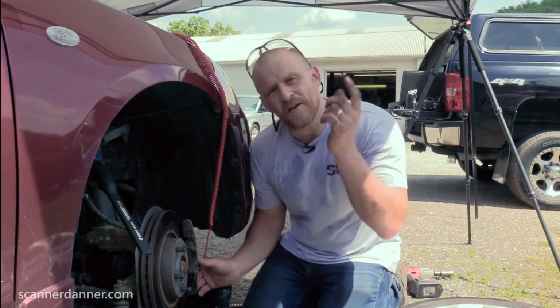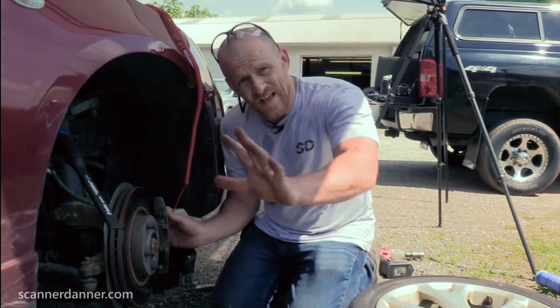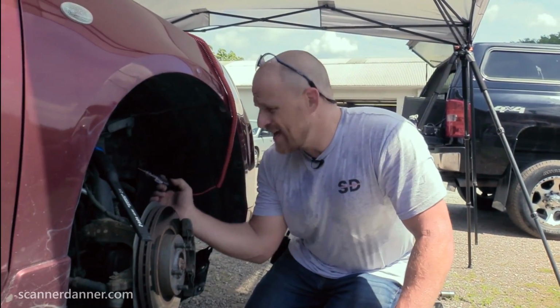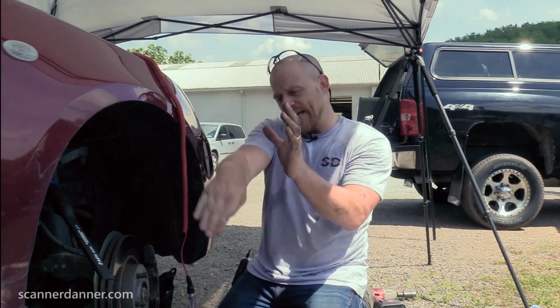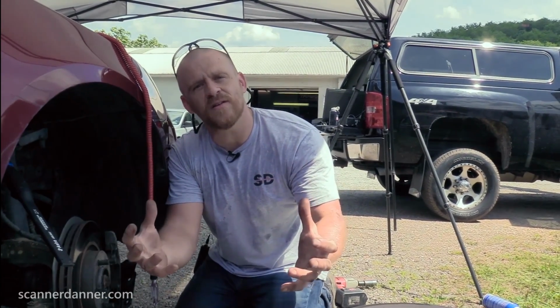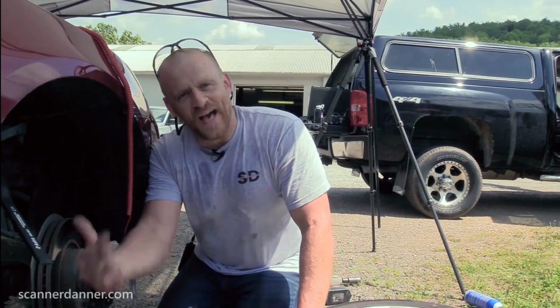That would mean the compressor doesn't have a ground, right? If the ground was bad, that means the compressor itself doesn't have a ground. So we send power in the coil, and then it goes into the ground of the housing. And if the housing isn't grounded, the housing just becomes an extension of the winding, and so it will light on the housing.